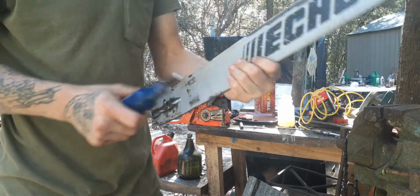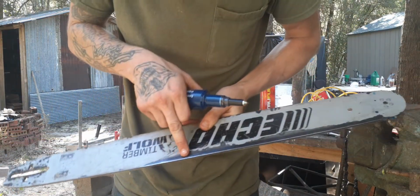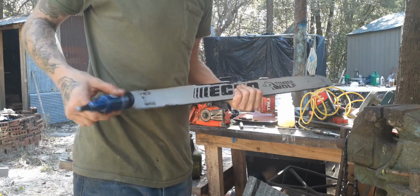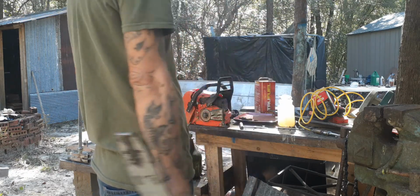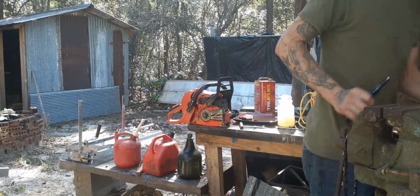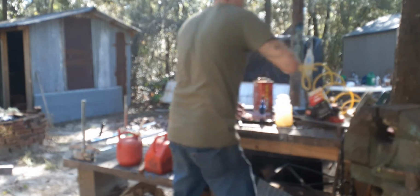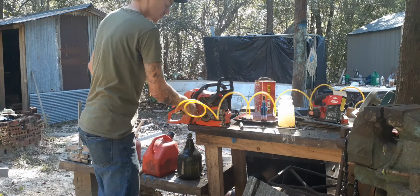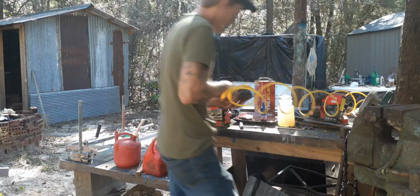Okay, so that bar is cleaned up, we're not using it. You guys see? Or it's not, I still got to blow it out with the air, but it started getting hot because it wasn't getting no oil because the oiler on the bar, the oil hose got clogged up with that wet, what's that? Let me think of the wood. I'll think of it in just a minute. Okay. Get that out of the way. Now, I'll take this here and blow this all out. Perfect. How's everybody doing?